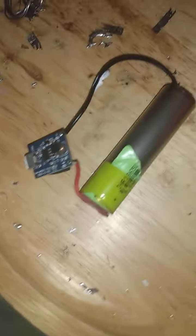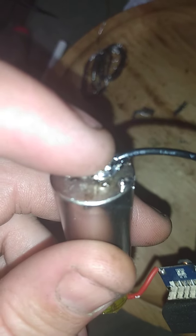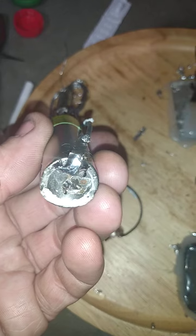So what we're gonna do is take our battery and put it in here. The soldering gun is heating back up. All you have to do is take this off, move your bubble of solder up, and solder to the edge. It's really simple. I'm gonna show you how to do that — it's the exact same way I did it here. I just wanted to show you the difference because that makes a lot of room available.